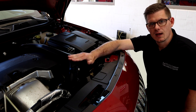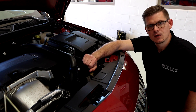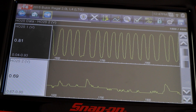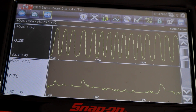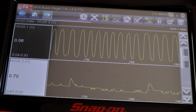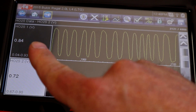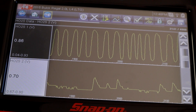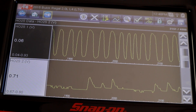We also look at not only the signal this sensor creates but how quickly it can react. Now let's look at oxygen sensor data on our scan tool — we've got our 2015 Buick Regal here, the car is idling and has been running for a bit. The 'H' stands for heated, so a heated oxygen sensor — really anything that is an OBD2 vehicle is going to have a heated oxygen sensor.